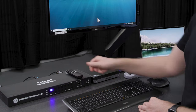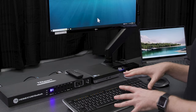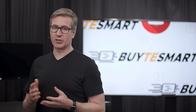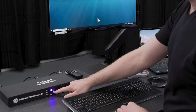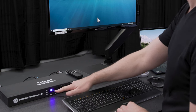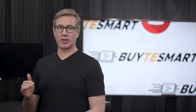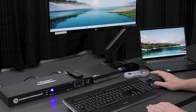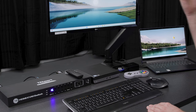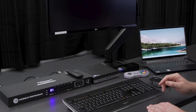Now if you don't have access to the front panel or the keyboard, you can also turn on mouse gesture switching. This feature is off by default, and to turn it on, you're going to press scroll, scroll, F12. You'll notice this little light comes on here on the LED, and now when you double tap the side of the screen, it's going to switch down or up depending on which side. So let's go down — we're over here on our Yoga, which went from 1 to 16. Now let's go back up, and we're here on input number 1, which is going to be our desktop.